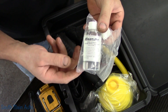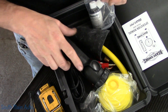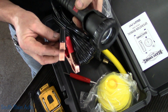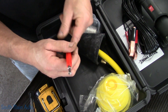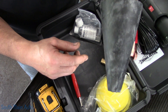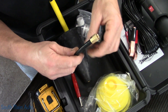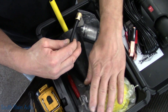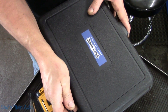In this kit it comes with a couple two-ounce bottles of smoke fluid — I've already installed one, which they stress in the directions to make sure you do. Comes with a hella bright flashlight that hooks to the 12-volt battery supply, which can aid you in finding the smoke. Comes with a core tool — on EVAP systems the Schrader valves are left-hand thread. You've got the universal cone usable in intakes, exhaust, or you can try to shove it in the gas hole. Also comes with our Schrader valve adapter for the EVAP purge line, and a whole bunch of plastic block-off cups. This is all we're going to need for this diag.